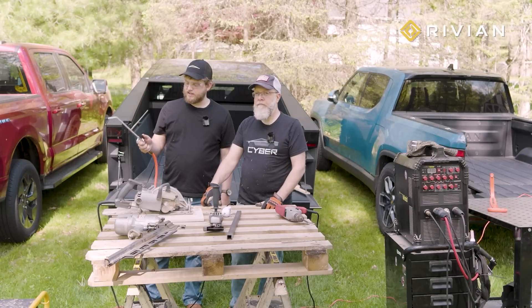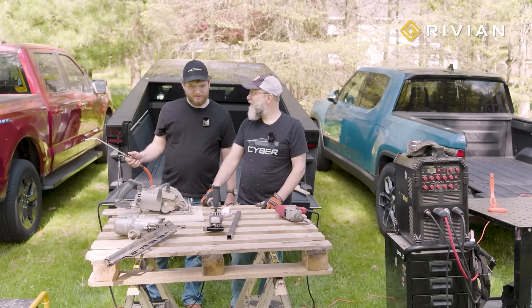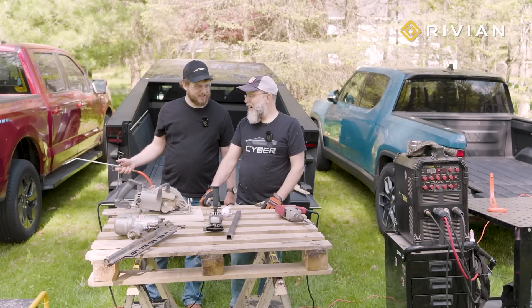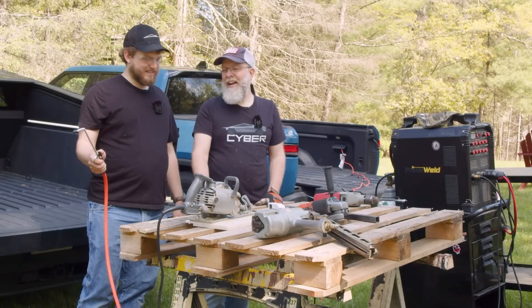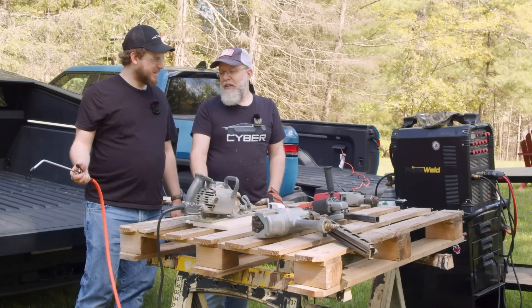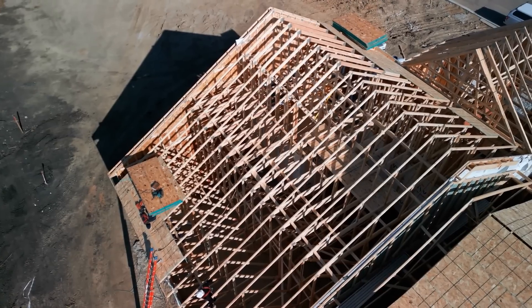Now for the Rivian — I doubt it has the power. I've blown up so many circuit breakers on 15-amp circuits with this thing. And it doesn't — it's not happy. You can hear the compressor motor struggling; it's not up to speed. This is a definite fail. It's just not enough juice. When you're on a job site, the last thing you want is to blow breakers. You want to hook up your air compressor, charge your cordless tools, string up some lights, and get to work.